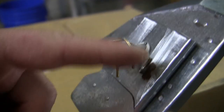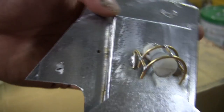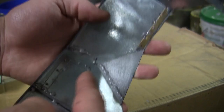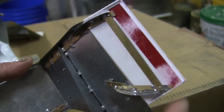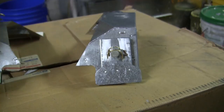The brush guard on the right side differs from the opposite version in that it is a round half-moon style, all made out of soldered brass, and it's missing the little footrest found on the adjacent side. Also notable is a small cutout on the rear portion of the fender for clearance of the exhaust manifold, as seen in previous videos. Other than that, the interior layout is exactly the same as a mirror image, and the same holds true for the supports. The only difference due to the shorter running board is that the strap is canted to shorten the running board length while keeping it sturdy.